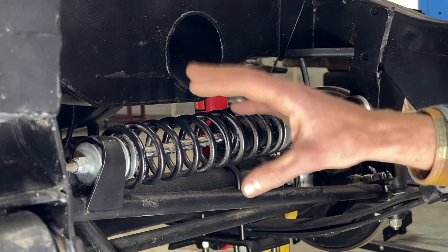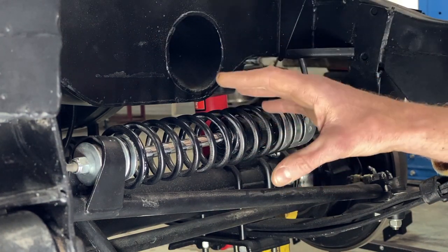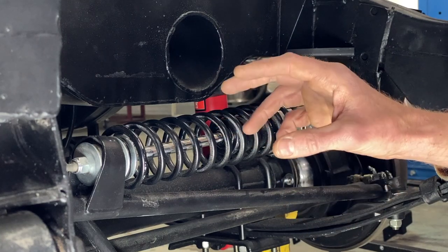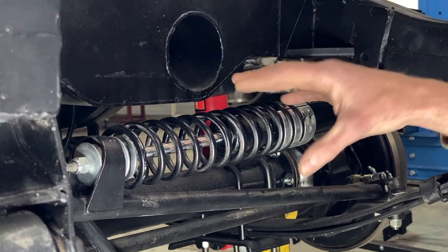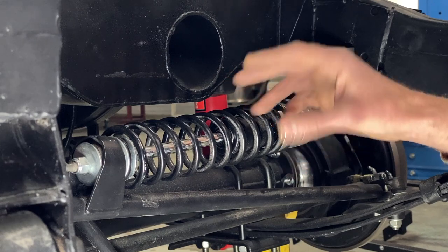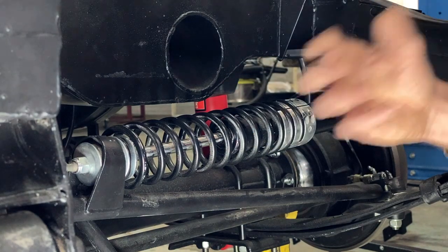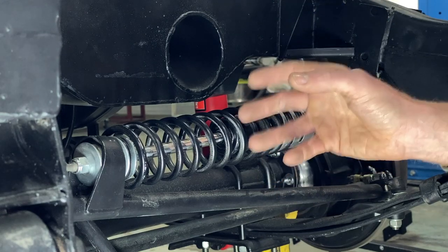Originally a Land Rover steering system, and this particular system really introduced in like '58 with the introduction of the Series 2, there was no steering dampener, and the relay here provided a little bit of dampening. And the steering wasn't that hard to use because you weren't forcing the steering through and into a dampener or a shock absorber, which has its own resistance.